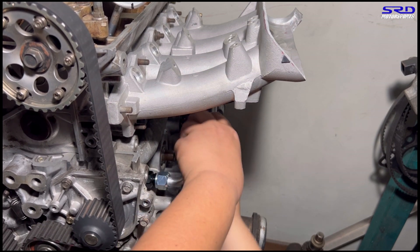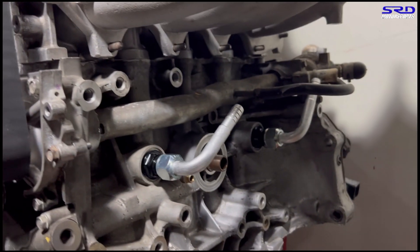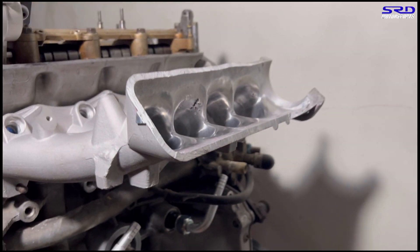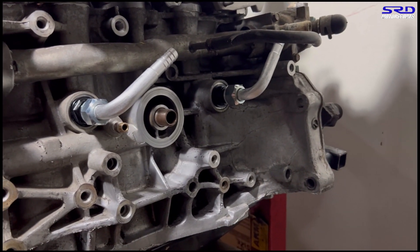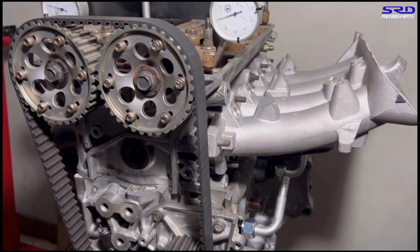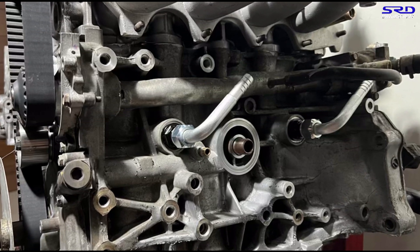Let's tighten it. It gets away from the oil filter, and when you install the hose, it just goes back to the catch can really well. Now you have two breather systems on the back of the block — this is going to help efficiency really well. This engine is going to be really good. Even Benjico is going to have an even more efficient B20 VTEC.